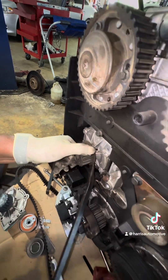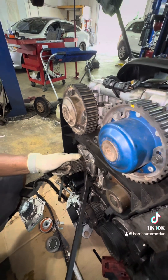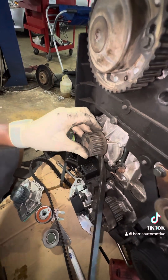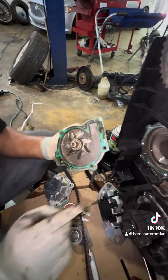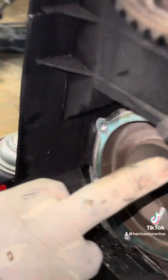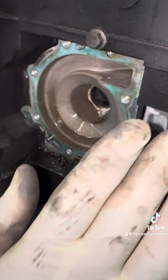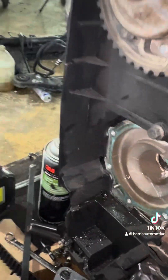So now the only thing we're going to do — we're going to make a little bit of a mess. There's a little dowel pin up top, and there she goes — she comes right off. Here's the most important part of this job: this here is a gasket, and I don't want you to be confused that you still have pieces of the gasket on here — you do not. That's just discoloration from the paper gasket. You do not have to worry about that. You can get some brake clean, spray some on here, and kind of clean this up.